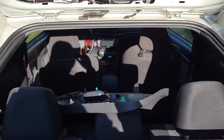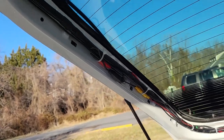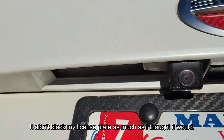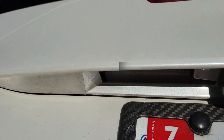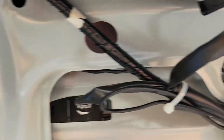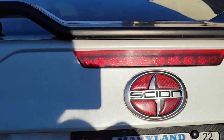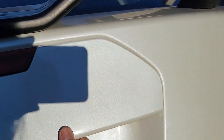Now to put the head unit back in place and then go around back and swap out the camera. I already have all the trim off — I'll put a link in the description below to my trim removal guide. Now to disconnect the camera and then pop out the rear hatch garnish. You can see I've moved my camera since the original video; it used to be way off-centered because the original camera source camera required such a large mounting hole. The park vision camera I replaced it with later required a smaller hole, so I was able to fit it into this spot instead. Remove the 10 millimeter nut here, the two here, unplug this harness, and then this last nut. Then come around to the other side and pull the garnish free — grab it from the bottom towards the sides. It's a little bit easier with two hands.